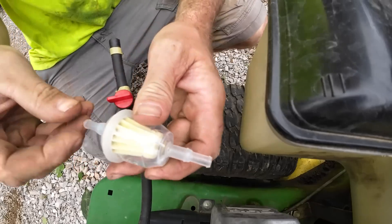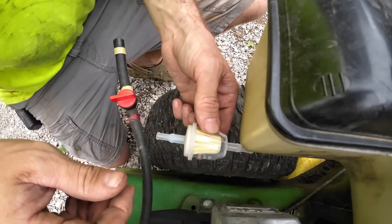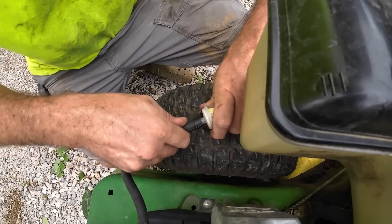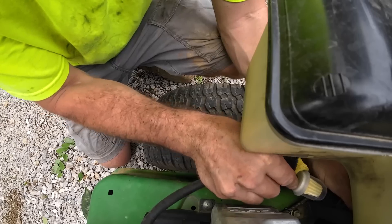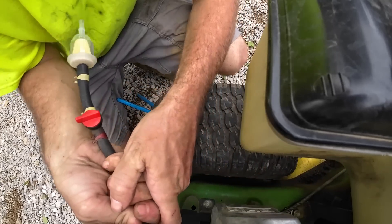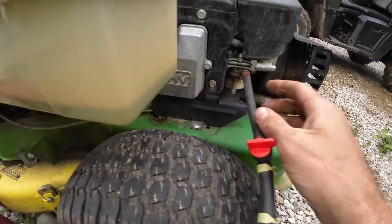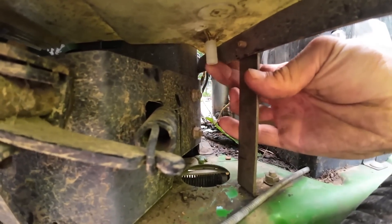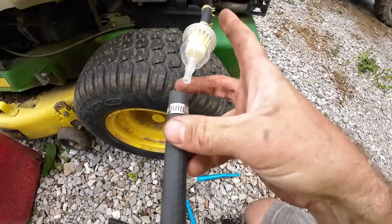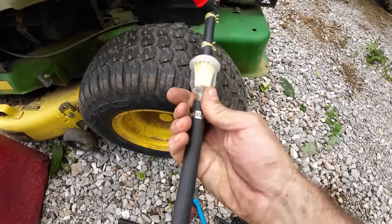Let me go grab a new fuel filter from the barn. Here's the fuel filter — you can see it's got two different sizes. The smaller one would go on there, and the large one you just push further on. Even the smaller one I still kind of twist and force up onto the bigger one just for the sake of it — always feels a little bit more secure. Why is that line so big? It's quarter inch on the valve side, but coming off that tank is a three-eighths hose. I found some five-sixteenths, and I bet we can force that five-sixteenths onto that three-eighths, and that five-sixteenths should work on the bigger part of the filter with an actual hose clamp.